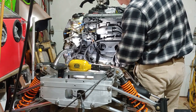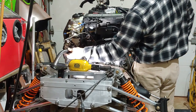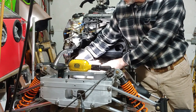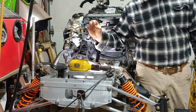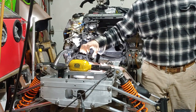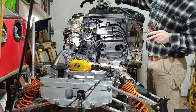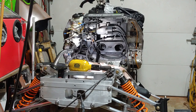Got a storm coming this weekend, finally, but we're gonna head up north. I don't know if I'm gonna get the 800 done in time though. I've done the same thing with coolant hoses — those were already on there. On my 700, the coolant outlet from the engine goes under the front mag side motor mount and it rubs on one spot, so I cut an old radiator hose and wrapped it — quarter-inch thicker rubber right over it, then hit it with three or four zip ties. Good old Menards — picked up a bag of hose clamps, eight bucks for ten.